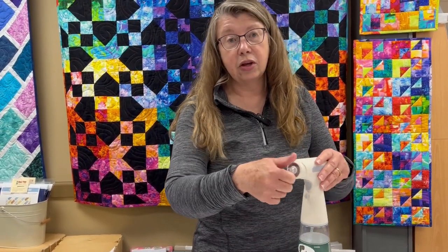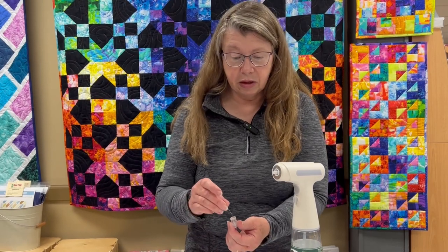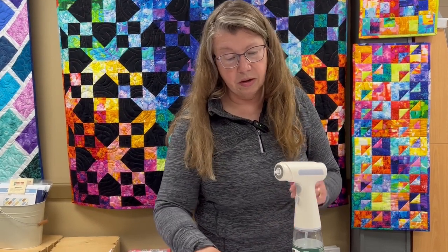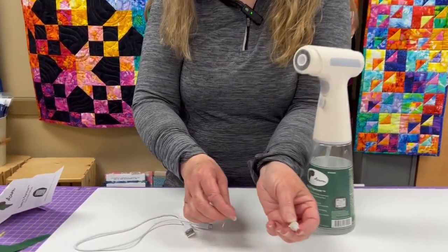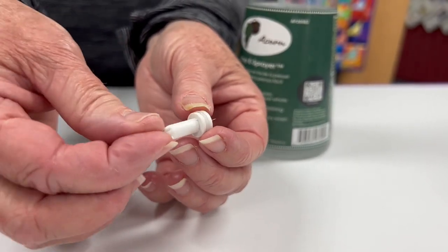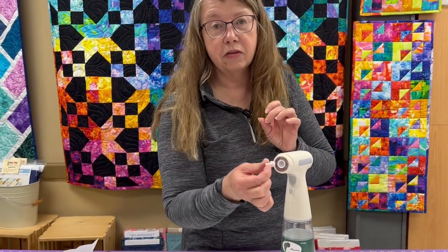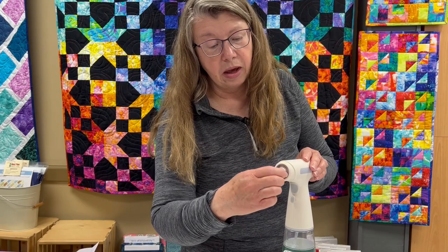If that is not doing the trick, you can take the nozzle off completely — unscrew it completely and rinse it in the sink if you want to. You can put a pin in to unclog it. There is one more piece here that a lot of people don't realize can come out — this little piece — and you can put a fine pin inside to clean it if there's any kind of a clog. This piece simply pushes straight back in; it doesn't turn, it actually has an o-ring. Push it straight back in, then go ahead and put the outer nozzle back on, and that will get your sprayer cleaned out if it's sat for a while and has gotten clogged.